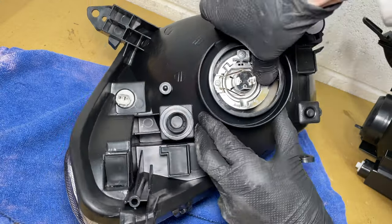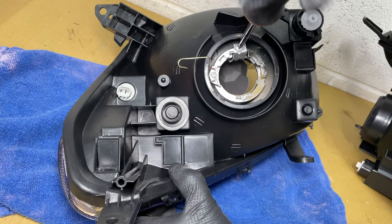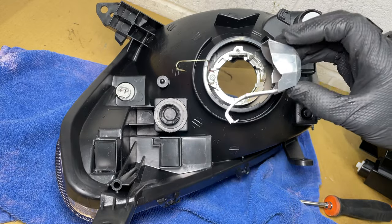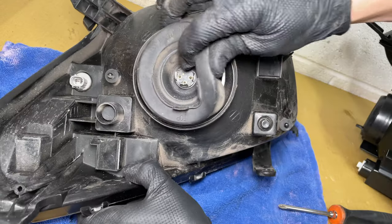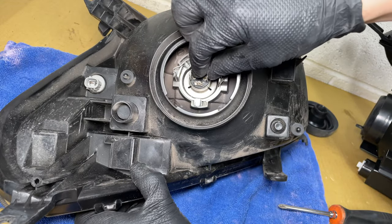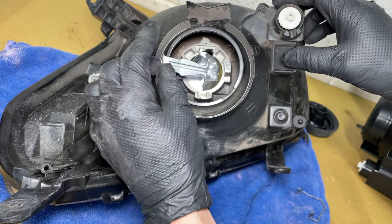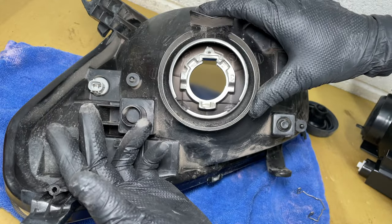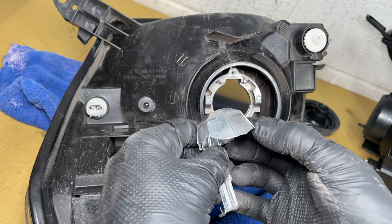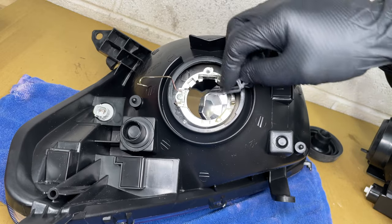Okay, fixing the new headlights. Release the clip and take the bulb out. A small Phillips head screw holds the little bucket piece in place. I could try to bend it back, but I don't know what angle it's supposed to be. I know where I can find some good quality Toyota parts — the clip in the old headlight is easier to use. Pull the bulb out and the small screw. This bucket doesn't fit through the hole — maybe it goes the other way. I pulled it out backwards and bent it a little, but I didn't bend the bracket, so it's all good.